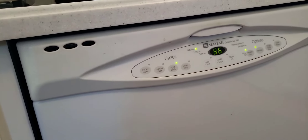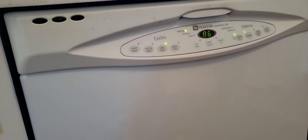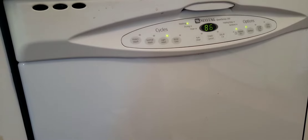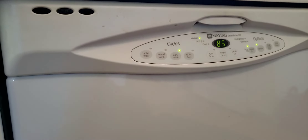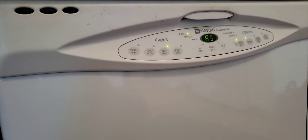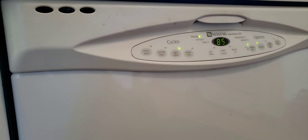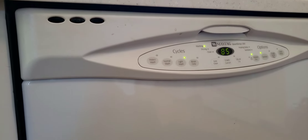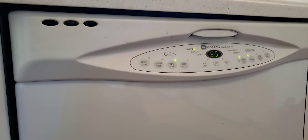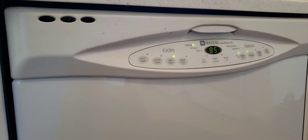Performing a service check to verify the water system power to ground. Checking the water shutoff system — the float — to see if it rises off the micro switch to turn the water valve off. The drain pump has been verified and is working; the dishwasher is now pumping. As a maintenance check, verifying the dishwasher shuts itself off to prevent potential overflow. The float has lifted off the micro switch, so the dishwasher should be sending power to the motor and engaging the wash system.